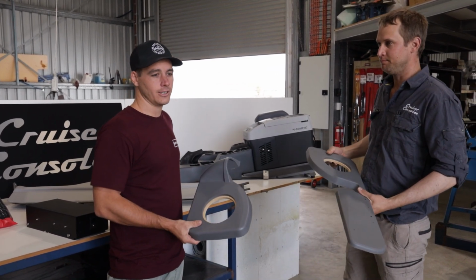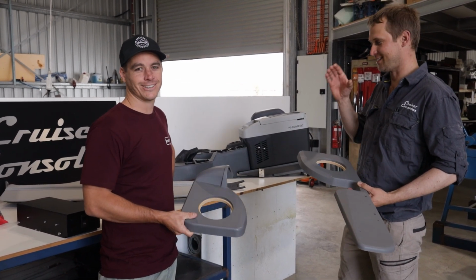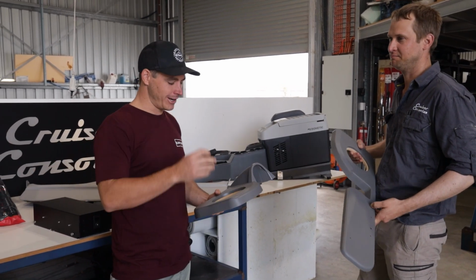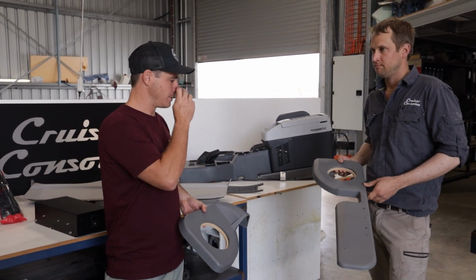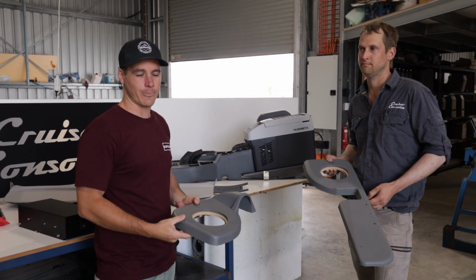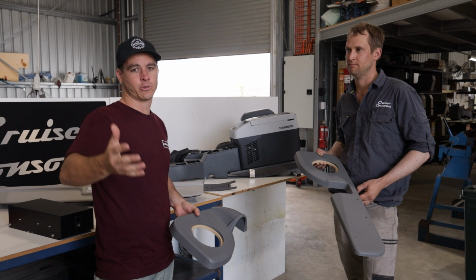So if you're familiar with the 70, you get two 4-inch paper speakers under the dash, facing down. The stereo system in these is horrendous, we all know that. So this allows me to do two 6-inches. I'm going to do 6-inch with tweeters in the front, 6 inches in the rear, and we're going to install a little amp to give it a little bit more bass, and that'll link up with the new head unit, and of course it's sound deadened.